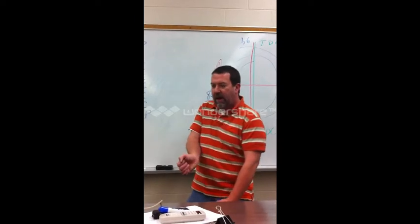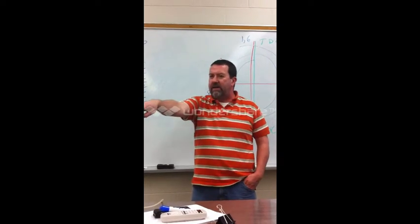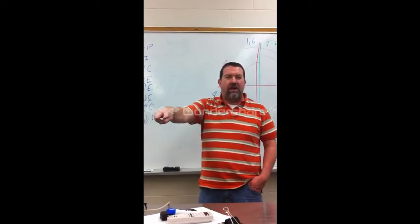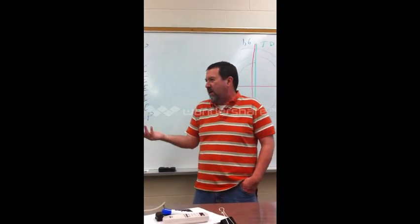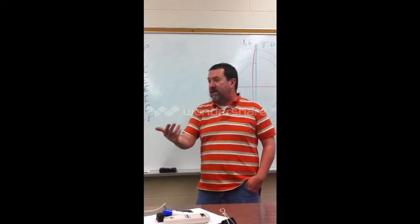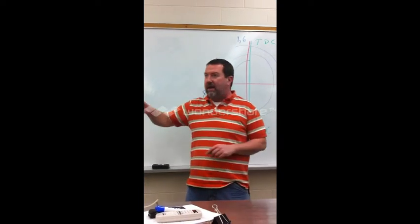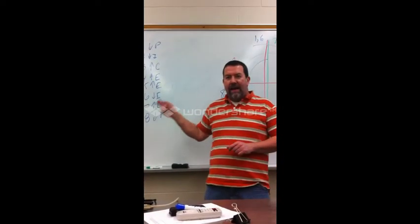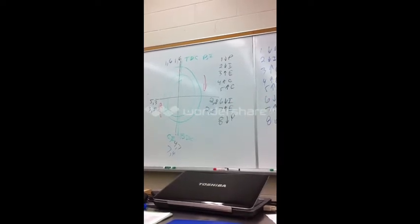I put a Johnson bar on there, I start cranking the engine over, I watch the valves on number one. If number one is about to fire, what are the valves going to do? They're going to do nothing, right? Watching nothing, does that tell us very much about anything? If I watch you doing nothing, does that let me know what you're doing? No, I have no idea. It's better to have some sort of positive indicator as to what's going on. So rather than watching one, maybe the valves are out of adjustment and they're just not moving, right? If I watch its mate, and in this case its mate is six, if I'm turning the engine and number one is about to fire, its mate, number six, what did we say it would be on? Intake. What happens at intake?